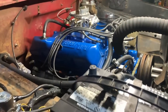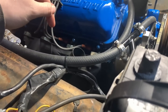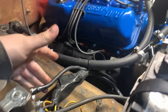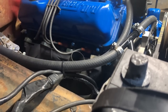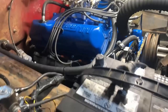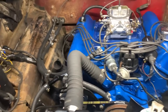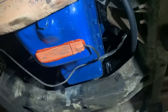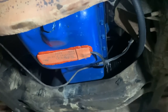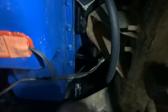Just little things here and there — zip tying stuff up like these heater hoses. I ended up taking my starter cable off and slid a chunk of heater hose down it to keep the heat from the manifold off of that cable. That's pretty much it for under the hood. I raised the truck up to show you underneath — there's the oil pan heater I slapped on. You just stick those on with high temp RTV and they usually stay put. I zip tied the cord up neatly and it runs up to that three-way cord.